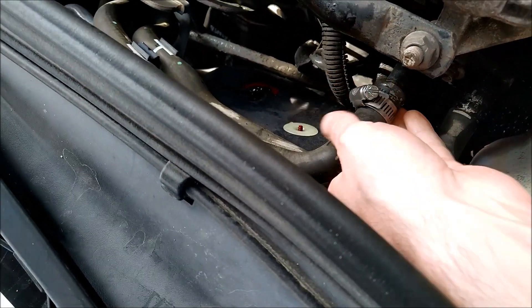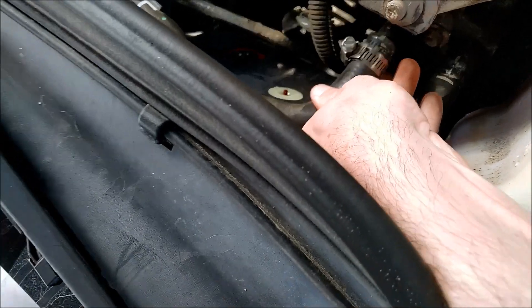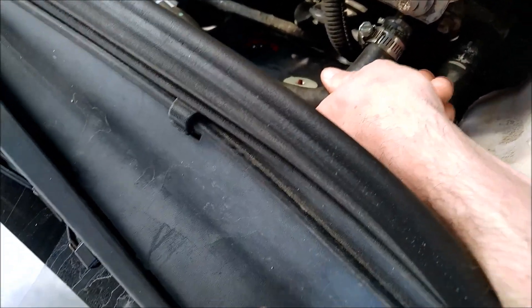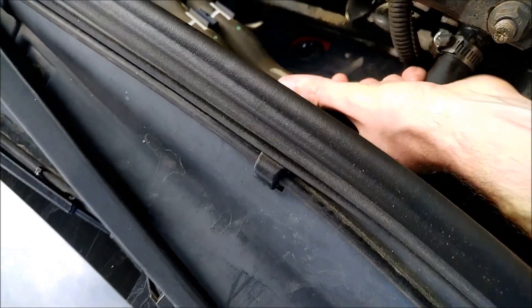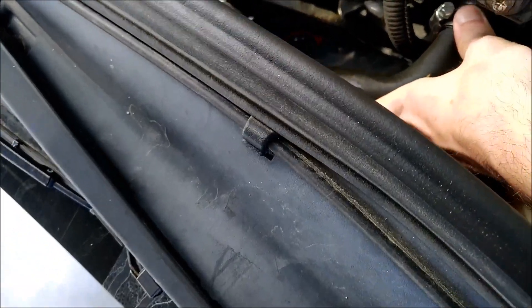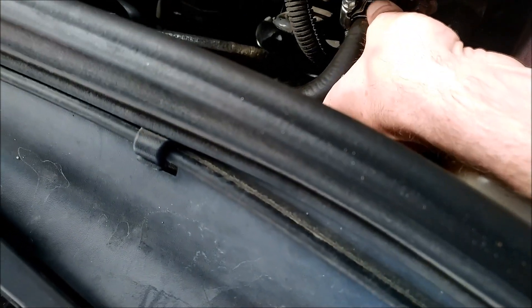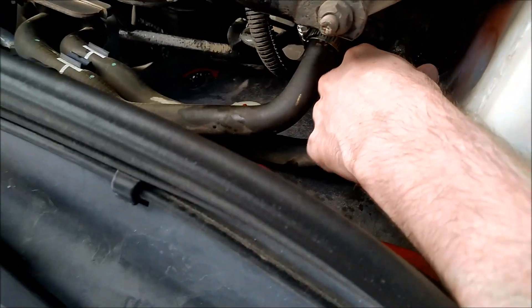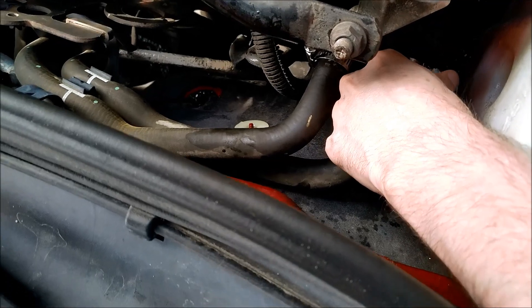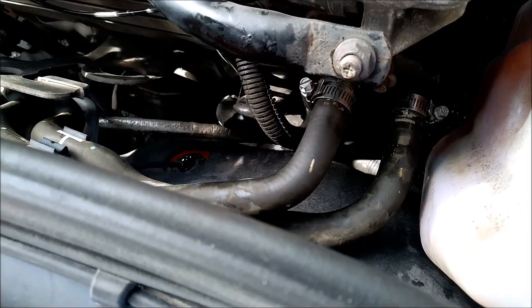If you have some concentrate, you can add like a hundred mils or so just to compensate for the water you're putting back into the system — because you can't really purge the water you fired through the line unless you blow it out with air. My coolant is already pretty concentrated so I'm not too concerned anyway. As you can see it's not that hard to reconnect these things — they're pretty soft, you just put them on with hand pressure, get your hose clamps back in place, tighten them up with a flathead, then test your heater inside the car and see how well it worked.